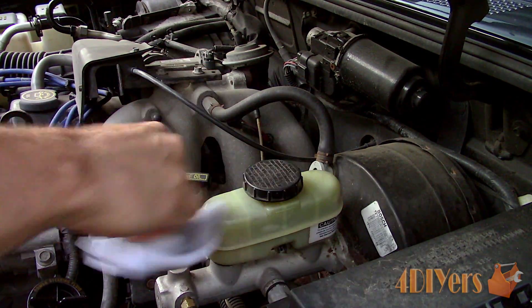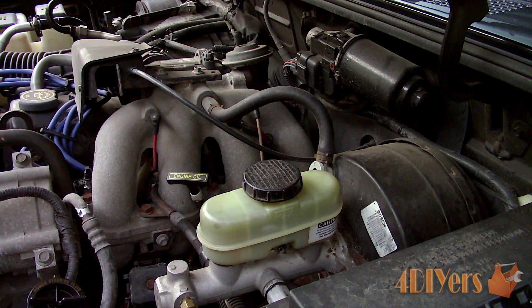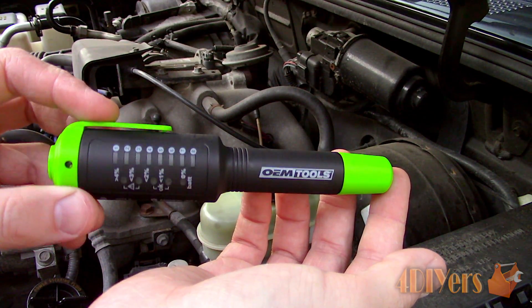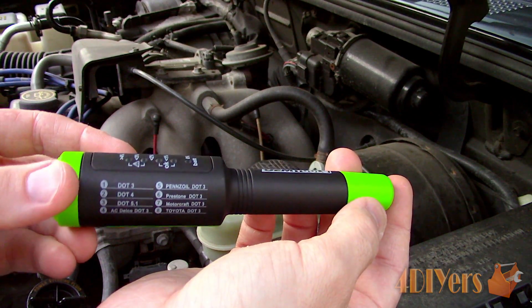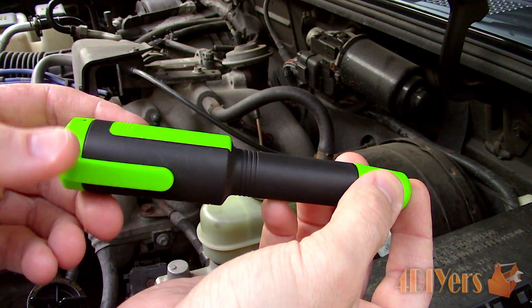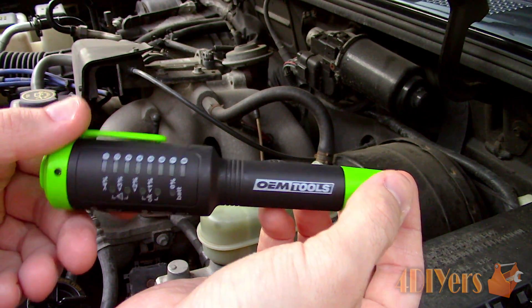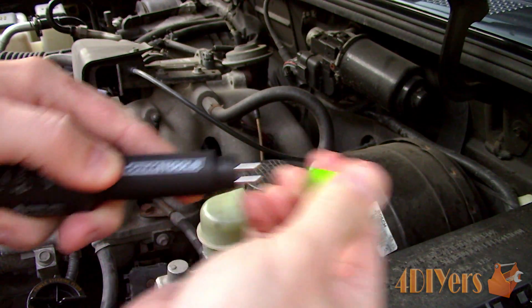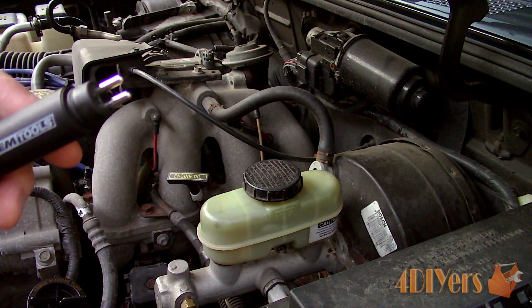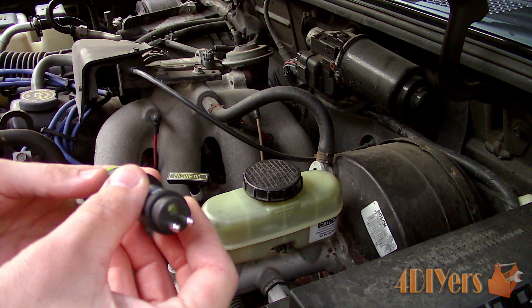For testing I am using an electronic brake fluid tester. The test can be done in under 5 minutes, is very accurate, and determines the boiling point by measuring the amount of moisture within the fluid. For this I am using one from Mobile Distributor Supply made by OEM Tools. A link to this product will be included in the description below. It's very affordable, easy to use, compact, and can be used multiple times on a wide variety of brake fluid types.